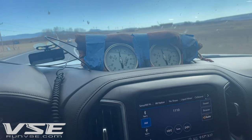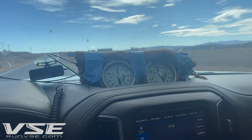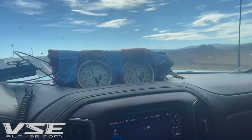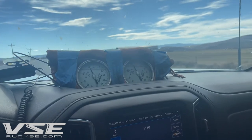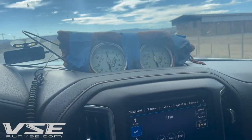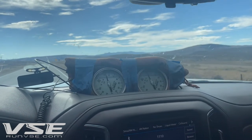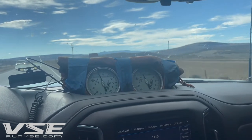That gives us a really good metric of how the turbocharger is performing. GM allows these turbos to run nearly up to 420 degrees, which is the end of the sensor scale from the factory. We're obviously going to hit that even with the more efficient turbocharger up here in the mountains, and a lot of times on flat areas, because of how hard this truck utilizes these turbos. There's a big intercooler that removes the sensible heat of air compression generated by Boyle's law — we can't really control that. Lowering boost pressure lowers compression heat, but if we're driving the turbocharger harder, we are going to make more heat from compressing air. I didn't invent Boyle's law and it is what it is.